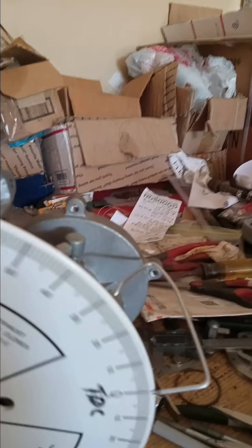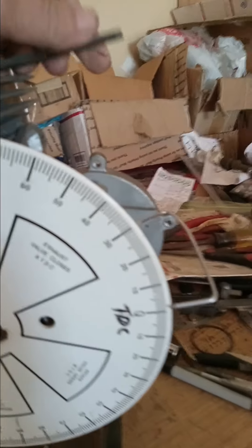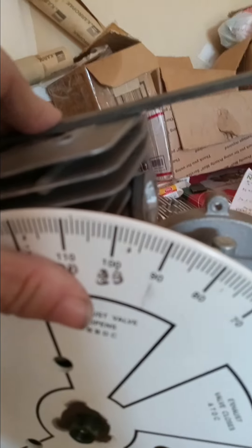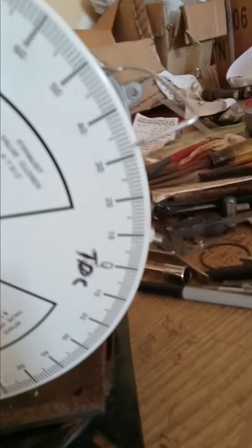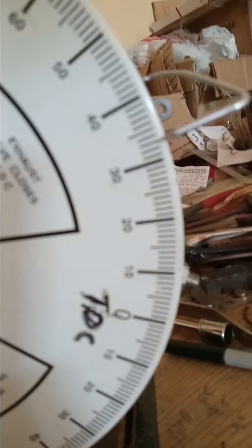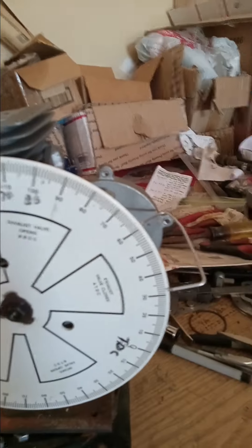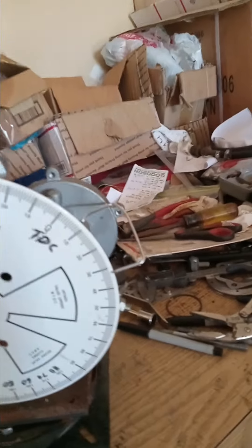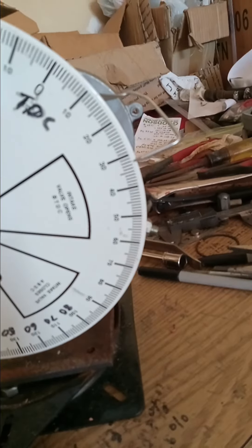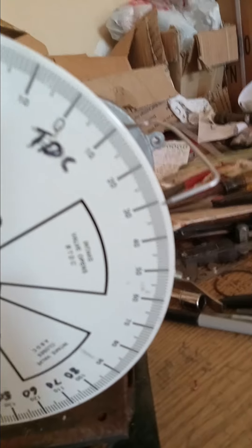You need a positive stop to make sure you're at true TDC — you can't just eyeball it. There's what's called dwell time, where the piston doesn't move, and it's about a 10-degree variant. I use a positive stop — something to stop the piston at the same moment in time. I roll my piston to the stop: it's at 37 degrees. When I go down and back up, if my degree wheel is correct, it'll also read 37 degrees.